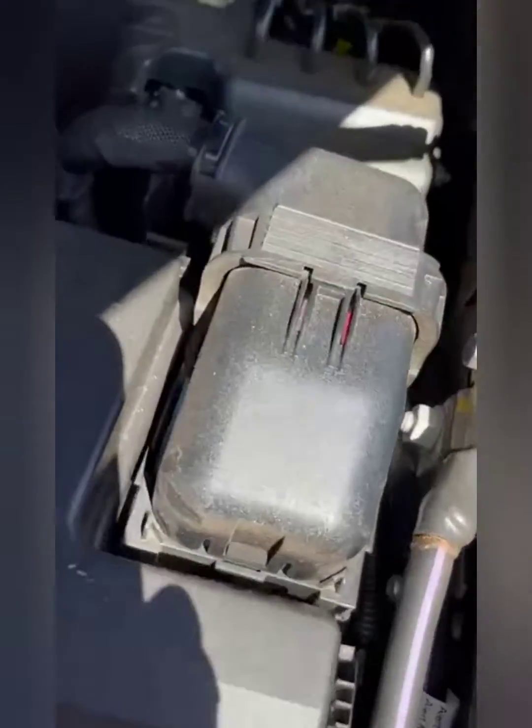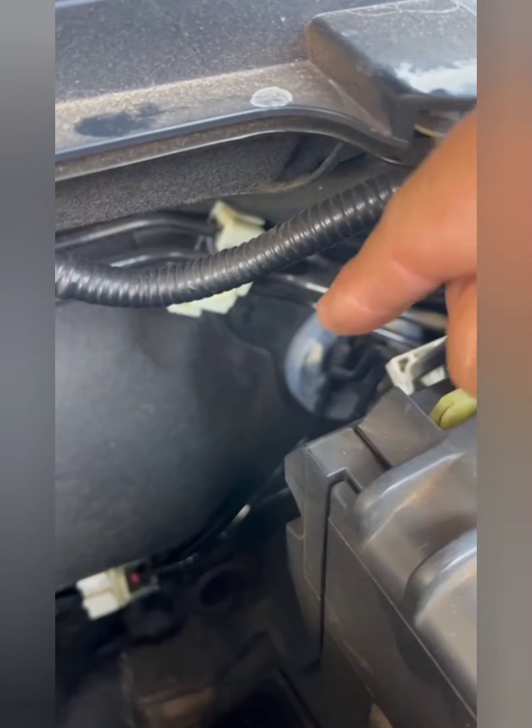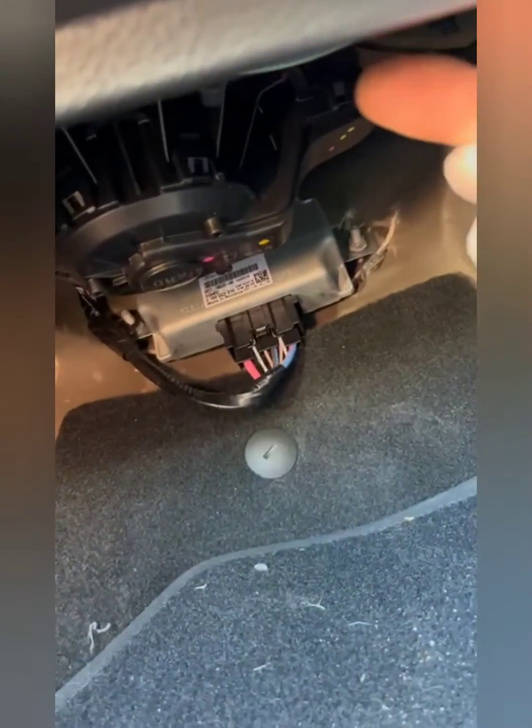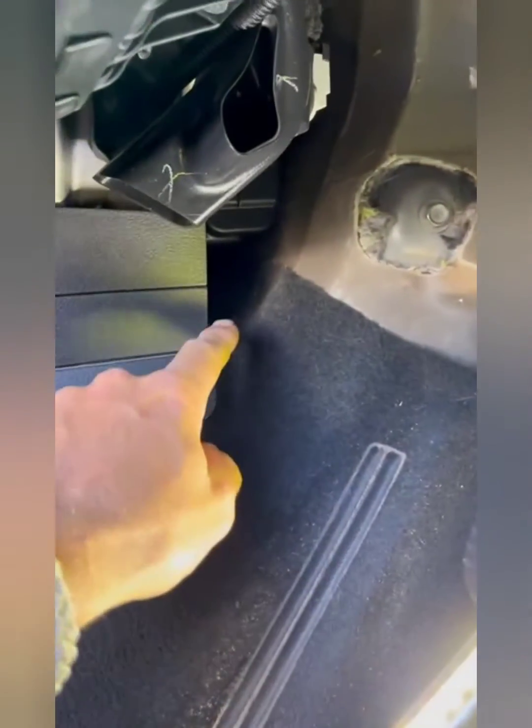That runs around and there's a little grommet down the back. There's like a little nipple thing — cut that off with a blade, don't use a drill. Then you can feed the cable straight through behind the fuse box. You can see the cable running through there and then up round. I haven't cable tied it up yet just to show you, and then it just runs across — there's a wiring piece there — and then straight through the tunnel over to the other side.